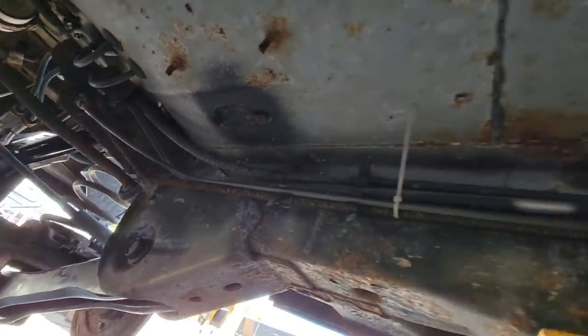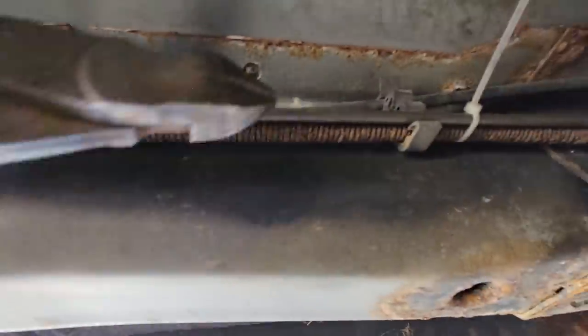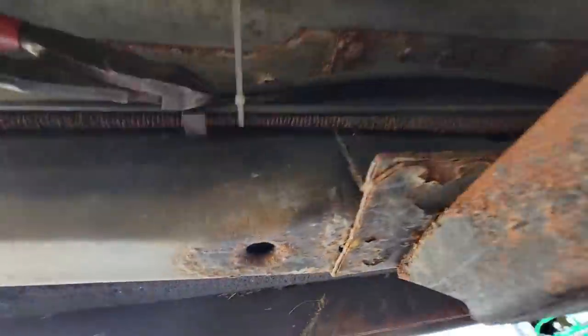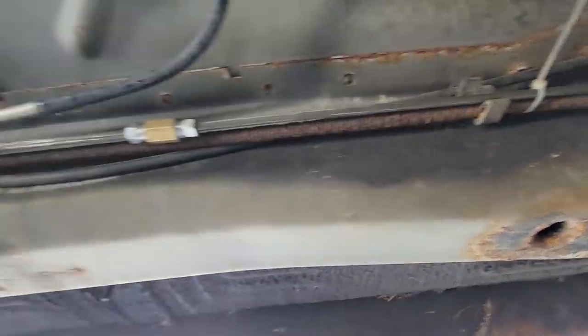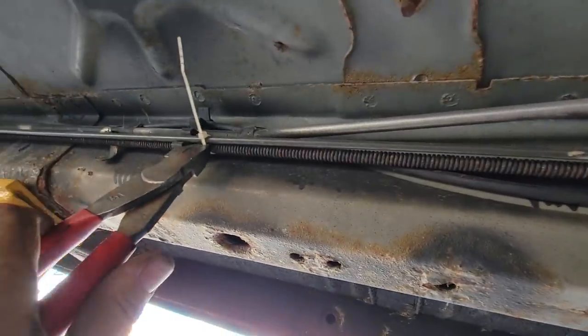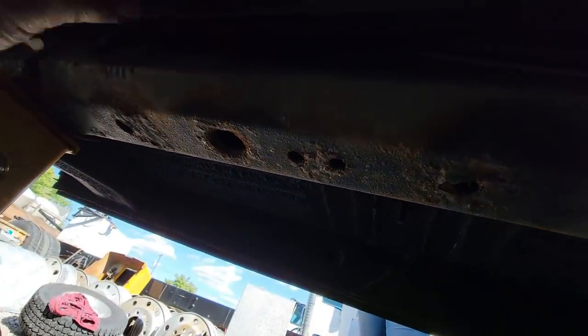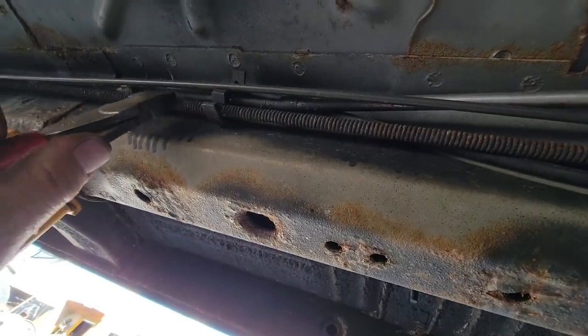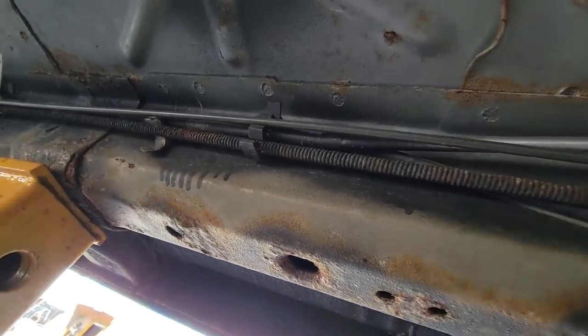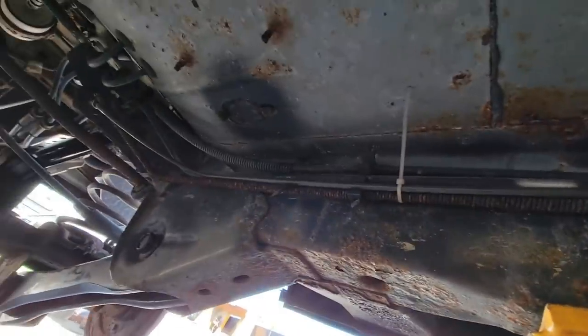You can see they're using the epoxy-coated Nappa brake line, but they didn't put it back in the holders. These little bitty zip ties aren't going to hold much. So let's get that back in there where it belongs. We'll cut out the old line and get it out of there. It doesn't have rock guard on it - which is what this spiral stuff is, that rock guard.